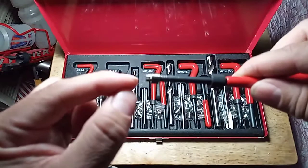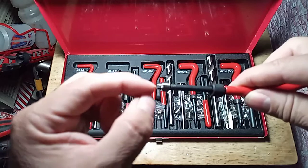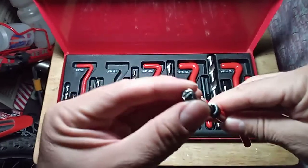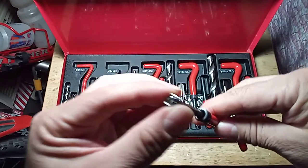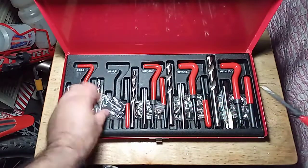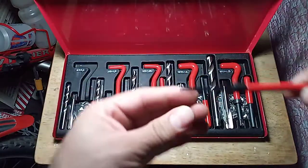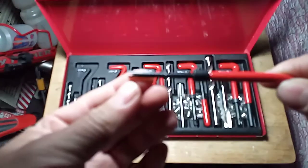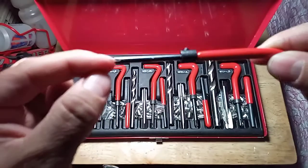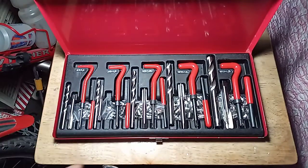And with the Dremel cutting wheel, I went ahead and sort of sanded those 2 inside sides so that the inserts, no matter what, don't get pinched on the tool. And there it goes down. So basically I did that for the smallest one too. Went ahead and cut a little bit, but let me see, there you go. And I opened that up so that the insert is free to move.